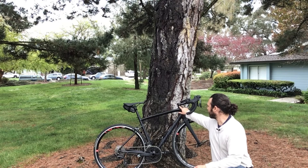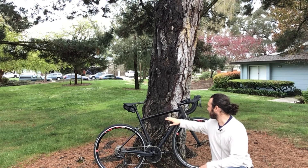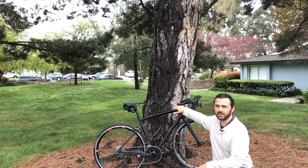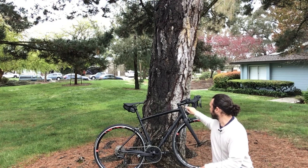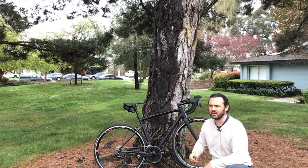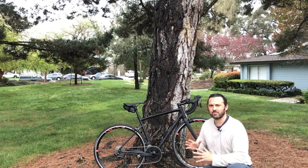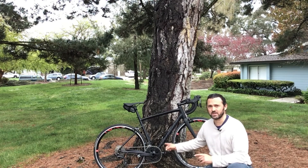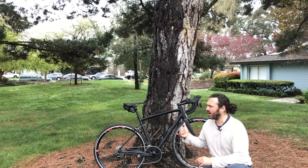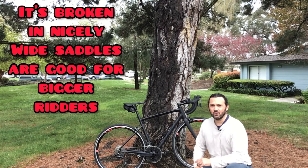I have the stem trimmed and I've slammed the stem. I have a really long torso, so I'm riding a 54, which barely has the standover height that I need — hence my saddle not being that high. But it has a really long reach, which is good for me. I'm still pretty propped up; I'm not in a super compromising position by slamming the stem. I did have to change the stem because of my long torso — I think the size comes with a 10cm stem and I run a 12. One thing I really liked was the crank arm length was perfect for me: 172.5. I wasn't in love with the saddle at first because it's a little sticky, but now I just rub a little olive oil on it and it actually works really well.